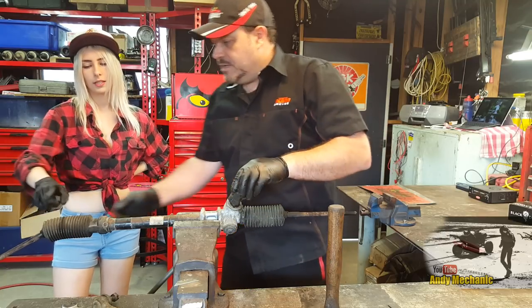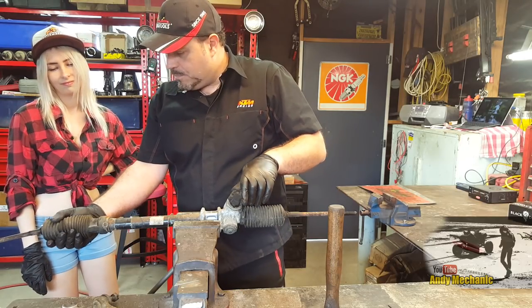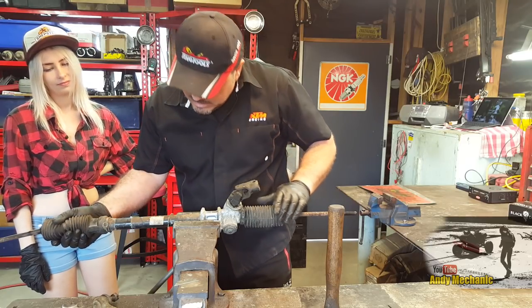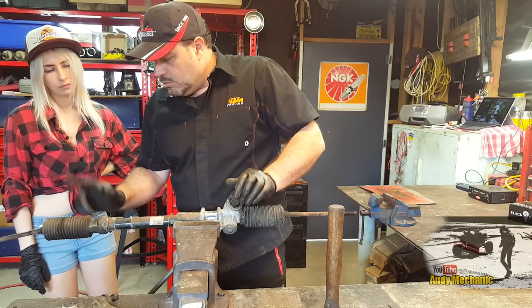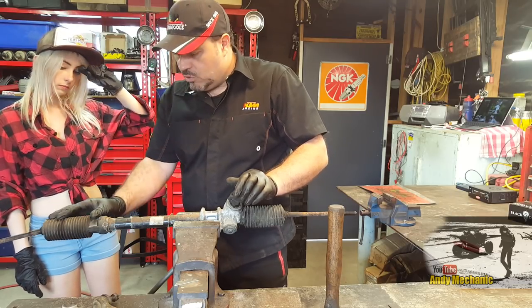Oh, and these bits, it's like an accordion. It's the first time I've ever been described that. It is a bit like a gator, isn't it? Yeah, you're right. Interesting. Okay, so we need to remove these boots. And again, it's a warrant fail if any of these boots have got a rip in them. They have to be fully sealed.